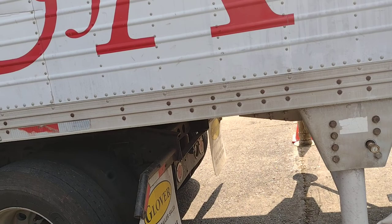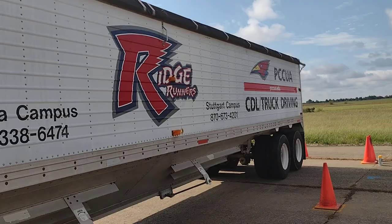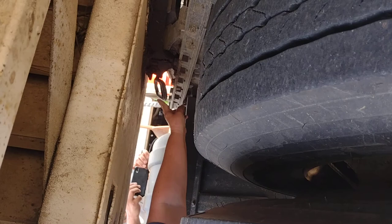I have six lights on the side of my trailer — four amber, two red. They are all properly mounted and secure. No cracks, no moisture. My fifth wheel: this is my apron, this is my fifth wheel. They are both properly mounted and secure. There is no light between my apron and my fifth wheel. My kingpin is properly mounted and secure, in between the locking jaws of my fifth wheel in the locked position.